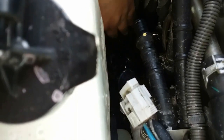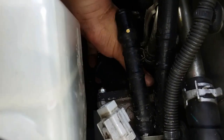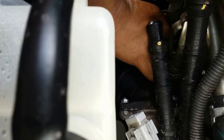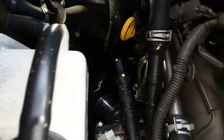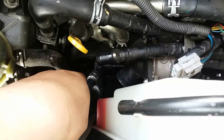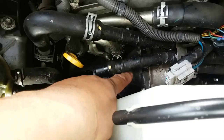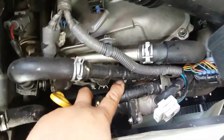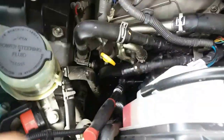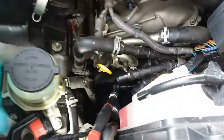Alright, stick that hose down at the bottom. Now we have access to our bottom nut — one, two, and three — perfect. So now let's go ahead and get these out. I'm taking out the bottom nut with an extension and a 10 millimeter socket. Here's the top one — this back one you might have to use a wrench because there's a hose in the way. So let me go ahead and break all three loose and get them out, and we should be done.